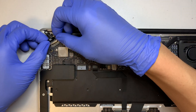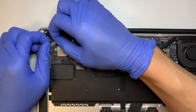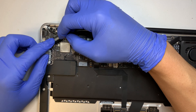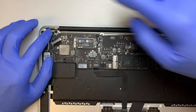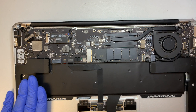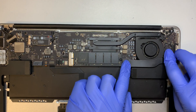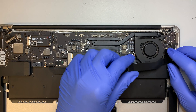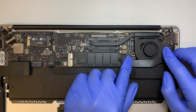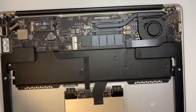Lastly, here is your LCD cable — slide it downwards, then push the clipper to clip it back on. We have now connected all the cables. For the final cable, push it in like a Lego — once you have it in the right spot, push it in and you can feel it snap on.